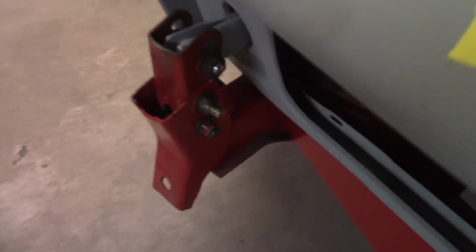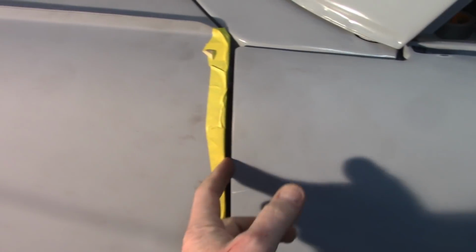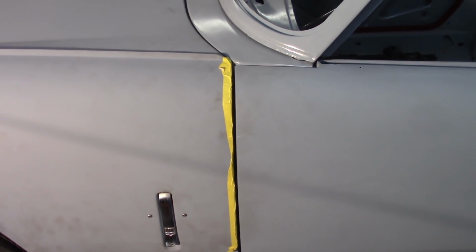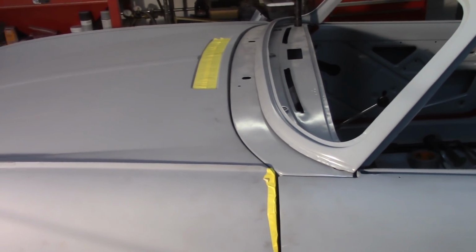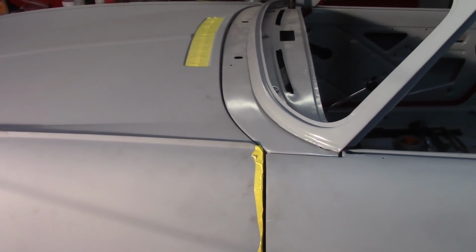And this end of the bonnet over here would have to come up, the top bolt there, and hopefully close that gap. Now what that does is then starts to throw off the vertical alignment here. Now this gap over here is not huge, but it's big, but off the door, not off of the sail plate. So I'm going to try to do this. I'm going to loosen up over here, push down, and try to open that gap up there.